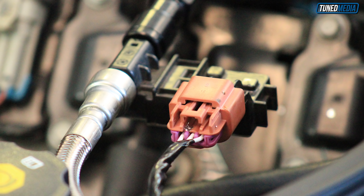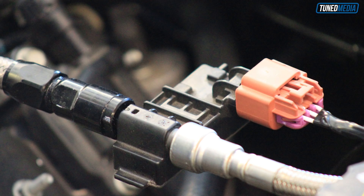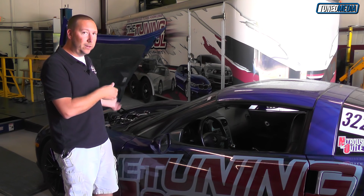Which is really awesome because that makes tuning much easier. So the configuration is good to go. We went ahead and tested everything to make sure everything was reading. We fired up the car and in the scanner you can see it says 9.4% ethanol content, which is pretty standard for pump gas. Pump gas typically contains up to 10% ethanol. So what we're going to do is put the E85 in the tank, fire up the car, let it idle, and watch the scanner to see how long it takes.